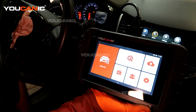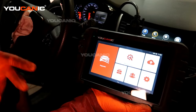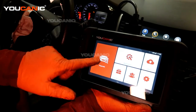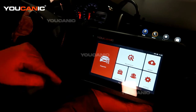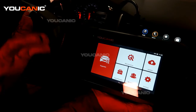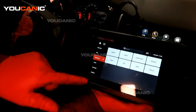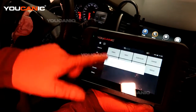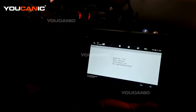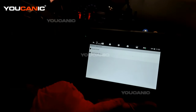We can check out what the sensor is telling us and then either replace the sensor or look to make sure that nothing else is causing it to go bad. We have the Ucan2 scanner hooked up through our OBD2 port, key on in the accessories position or in the run position but not started. Going into diagnostic, we'll pick GM because this is a GM vehicle, then do the smart VIN and hit yes because it's bringing up the right information.